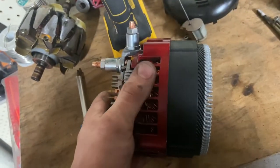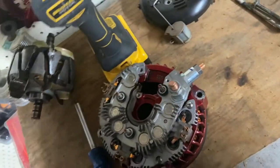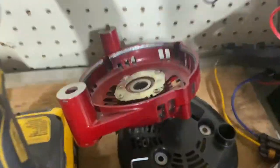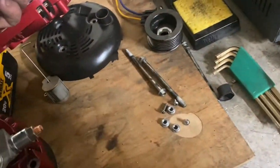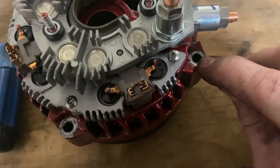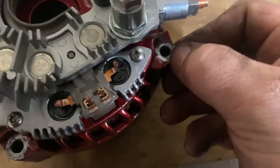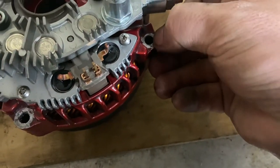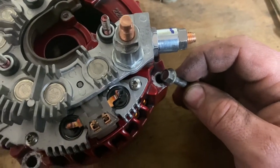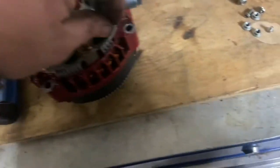I was using a drill to buff off the edges of the SRE housing. The other side is called the DE housing — the drive-end housing. I used a little rasp bit or sander bit and go around the inside to get it cleaned up good. This edge right here where the bolts go through — at the factory it only sanded off about where my finger's sitting, so you only had the edge of this bolt connecting for the ground. I like to give it as many opportunities for that ground connection as I can.